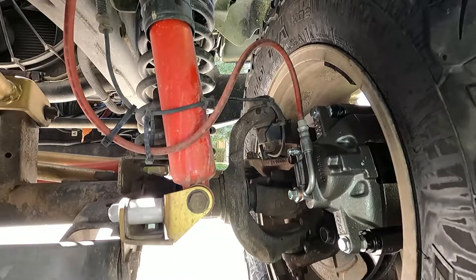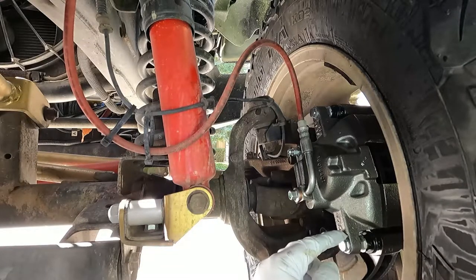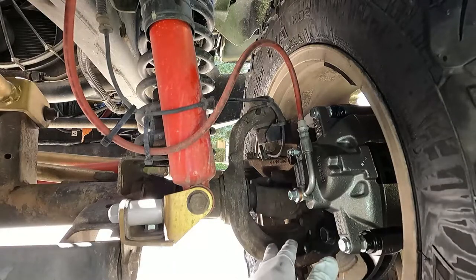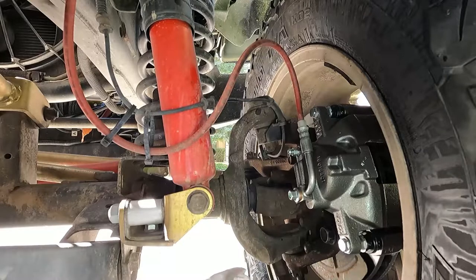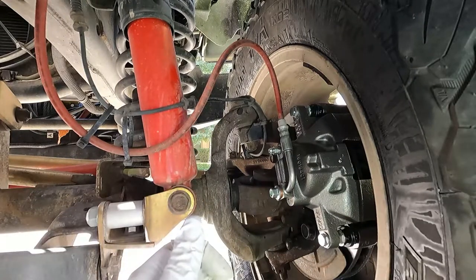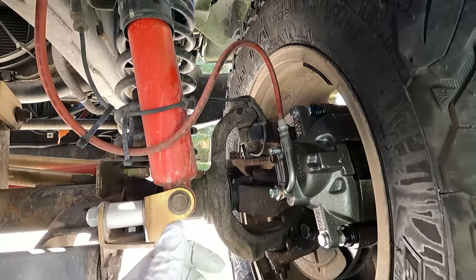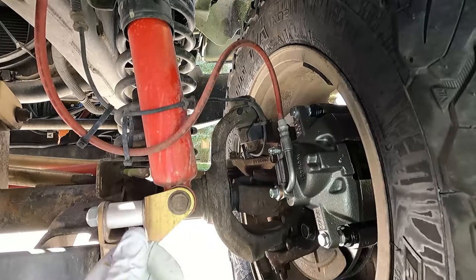Just remember when you do a test drive with new brakes - even if you're not bleeding the brakes - go ahead and step on the brake pedal several times first to push the caliper piston back out, pressing the pads up against the rotor where they need to be. That's pretty much everything. I hope you liked the video - please give it a thumbs up and subscribe. I'll get a link in the description where you can pick up some of these parts and tools as well. Thanks so much for watching and good luck.